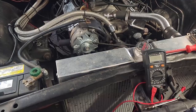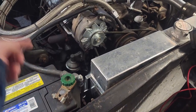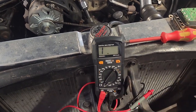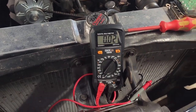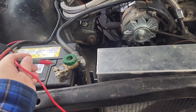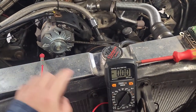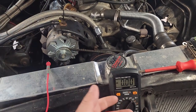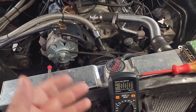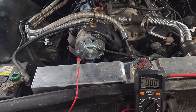So what I did to test for that is — this is a quick disconnect at the battery, so this cable is actually disconnected from the battery. I've got a multimeter out on amps, grounded right there at the horn. I'm going to take the other lead and put it to the battery. You can see right now it reads zero, which is what you want. You may get a very small reading like 0.05 or something like that because your clock or the presets for a radio — small things like that could have a very little draw — but mine was way high.